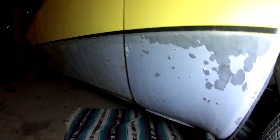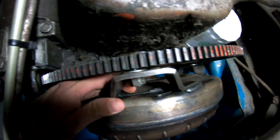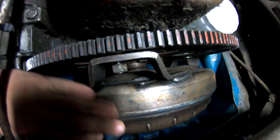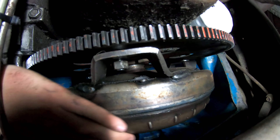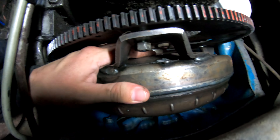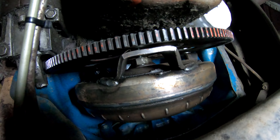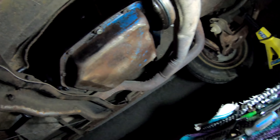This thing was so close to being a running, driving truck but I have to do a little more work. I thought maybe I didn't have enough washers in between here to space it into the transmission so it wasn't connecting into the pump. But the way I have it, it only moves a tiny little bit — if I put one more washer in there it would be bottomed out as tight as it goes to the trans, and I know they're not supposed to go that way. I don't think it's that, so I'm just going to remove the torque converter bolts.